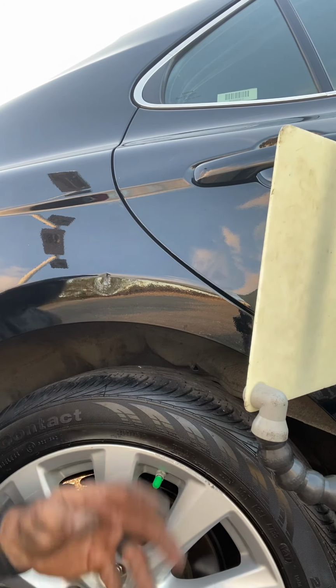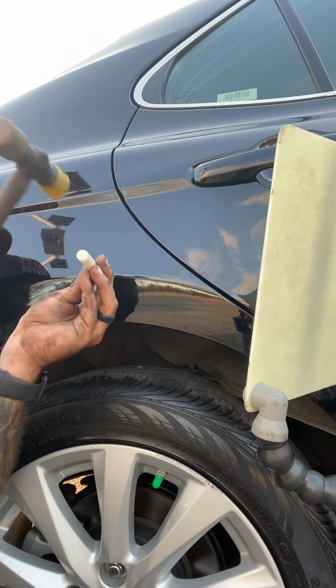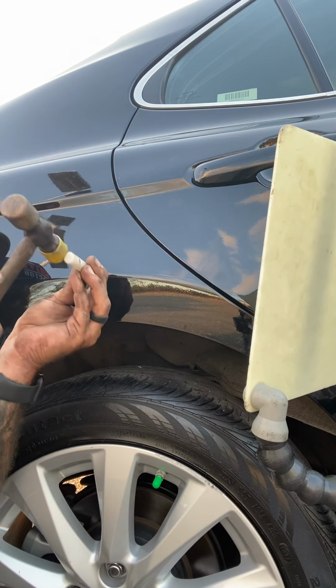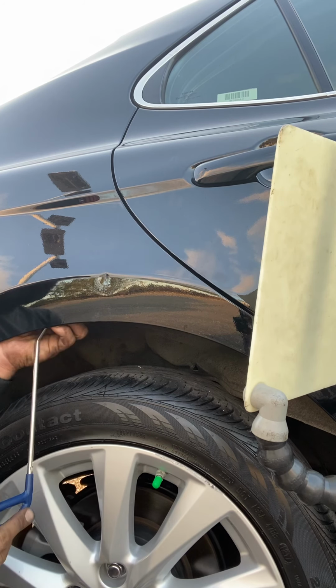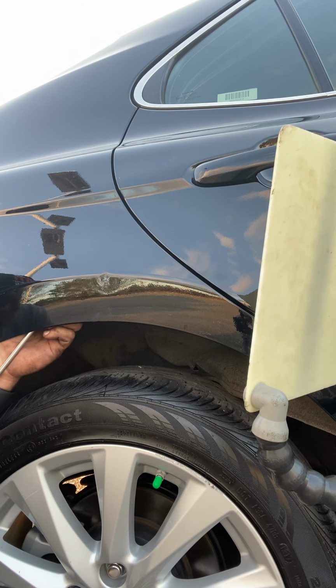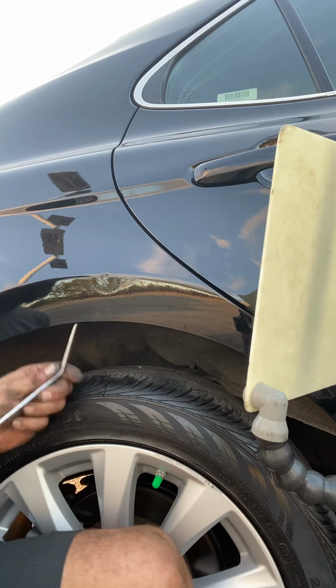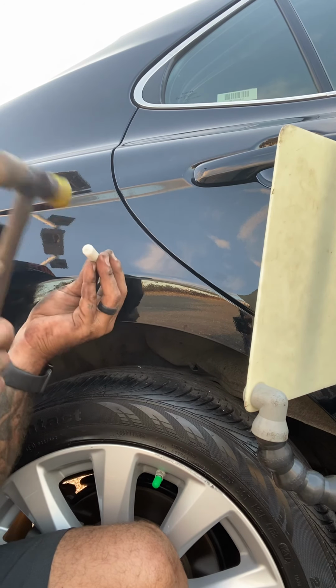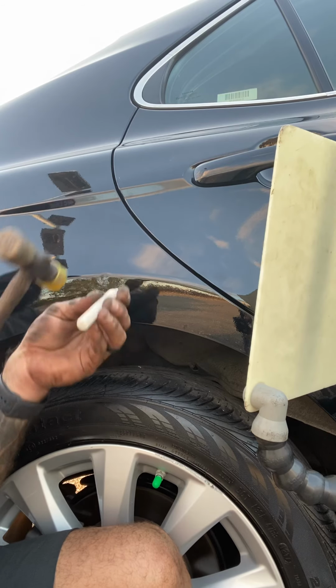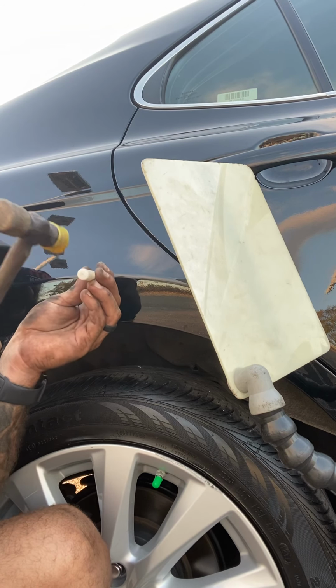There's still a little rail right there. See if I did a good access there. So I got good leverage. So the only dangerous part of using a sharp tool like this is that you can easily chew it up fast, especially that body line. So that's why I'll push and knock down and push and knock down and try to get that pancake out so it's not so abrupt of a center crease. Because right where that door hit makes it too sharp to, when you do try to push it up, make sure I'm not blocking that. It wants to give way quicker.